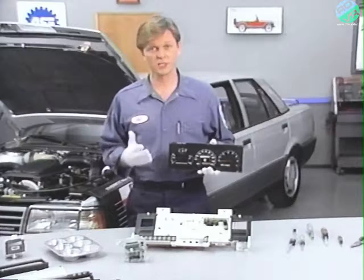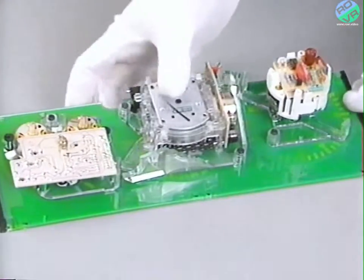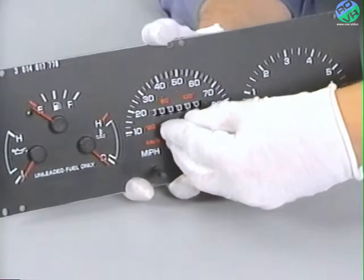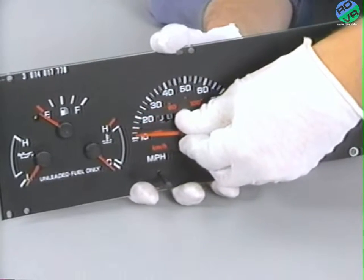The installation of the speedometer is similar to that of the tachometer. First, position the speedometer and secure it with two screws. Align the pointer tip with the 90 mile per hour mark. Grasp the pointer by the hub and gently push the bushing on the movement shaft, using the same alignment procedure